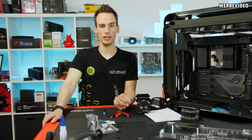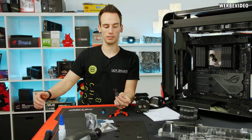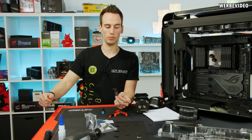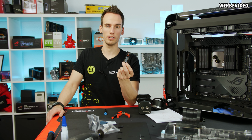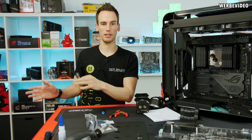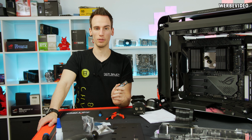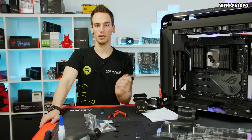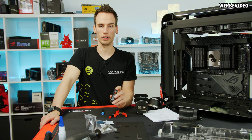Technically it was a very, very nice solution because it really speeds up the HDD quite a lot, but when this one was gone I lost quite some data from the Samsung drive, and I also lost some data in the combination of the Optane and the HDD, which was really annoying. And that's one of the main reasons why I went with the U.2 drives and have them running in RAID 1. So if one of them fails, I will just buy the exact same model again.